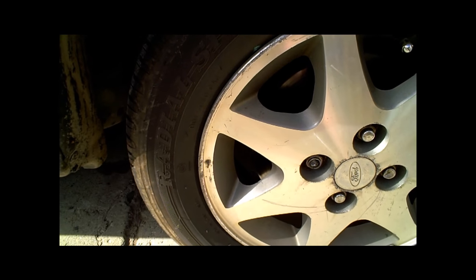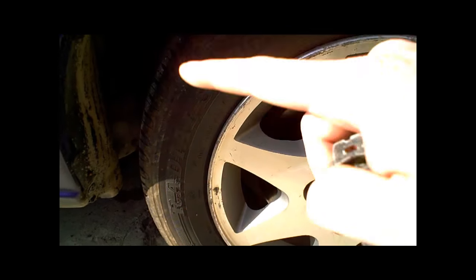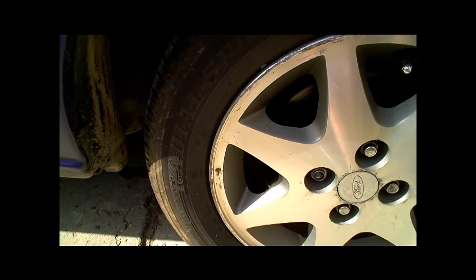So it's about a 16th of an inch off, which is within specs. The car drives straight now. The problem is, once you bend a piece of metal it's virtually impossible to get it perfectly straight again. I can still jack it up and hammer underneath, try to hammer it straight.